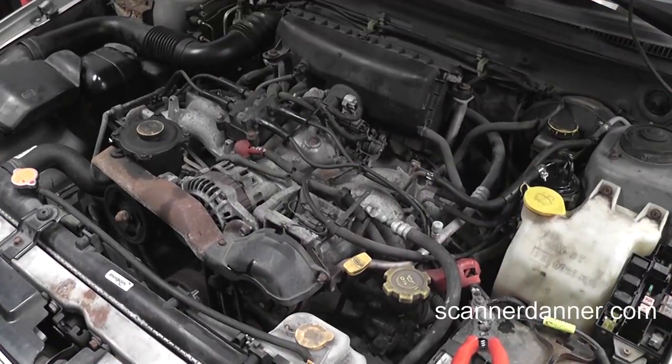I have this battery charger on start mode. The battery's weak — we're fighting a lot of different things here. Go ahead and crank it again. Nice. I was scared there for a second. Did you hear the popping through the intake? I was worried about a valve issue, connecting rod — you hydrolock an engine, anything can happen. Just leave it idle. Well, I'm a happy camper right now. That is a definite fix.